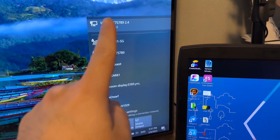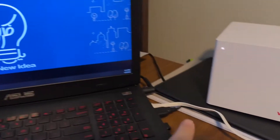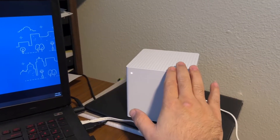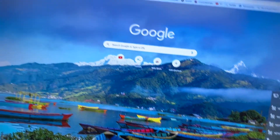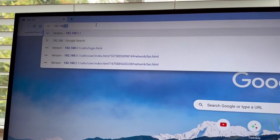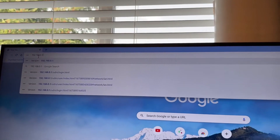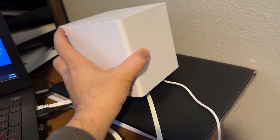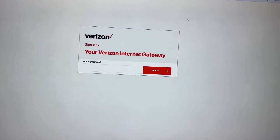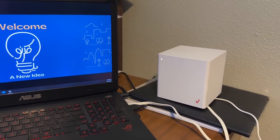I am now connected to Verizon via ethernet — not through Wi-Fi, actually connected with this cable. When you see that, you need to go configure some settings on this box. You do that by going to the URL 192.168.0.1, which is printed on the bottom of the box. It also has a password there — there are two passwords, use the second one for that URL.